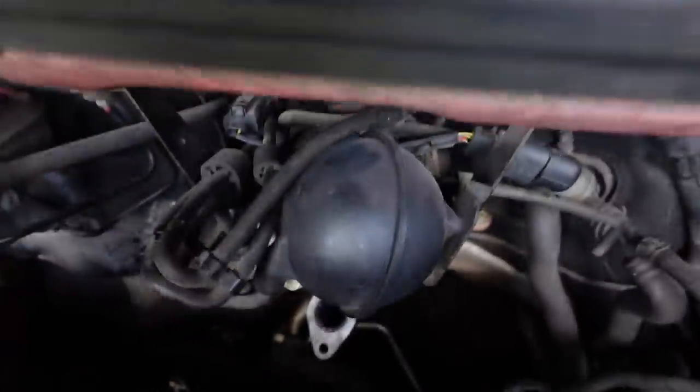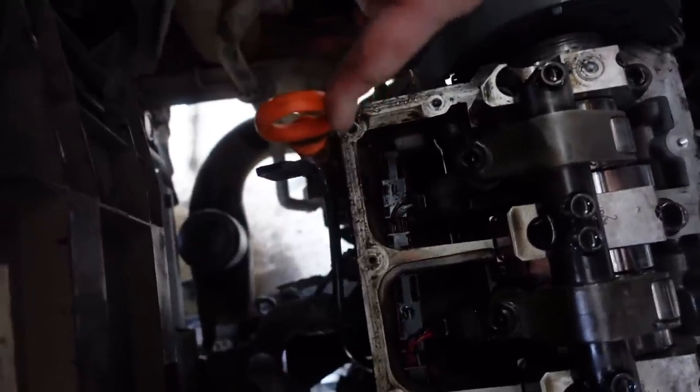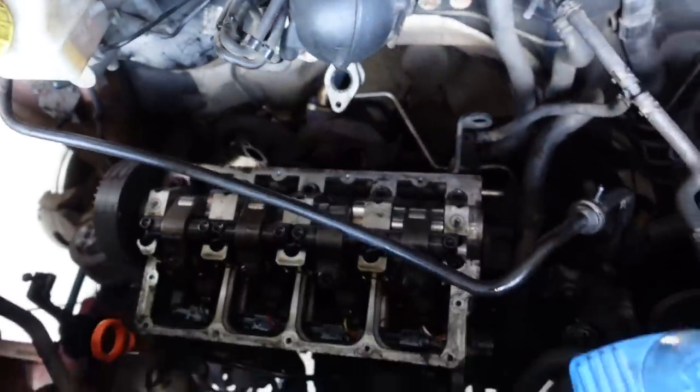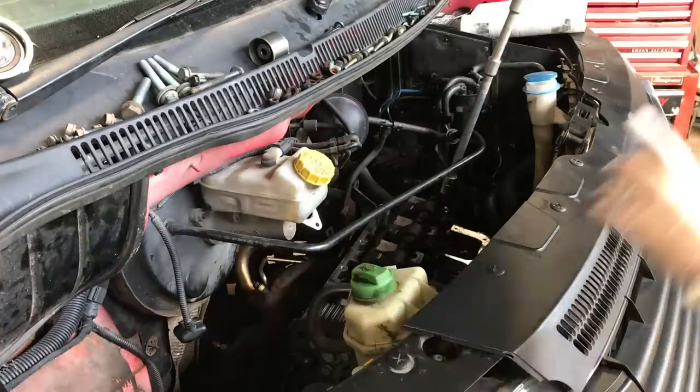Progress has been made — we've got the exhaust manifold and turbo all off and resting at the back, the coolant junction off, and the vacuum pump off as well. We'll undo the dipstick bolt, take the cam belt off, and then start taking the head bolts out. Big shoutout to Mikey at Transporter HQ for lending me his long spline bit — you need one that length to get the head off. Haynes manual says to use a multi-spline tool on the cylinder head bolts, working from the outside in, evenly and gradually.